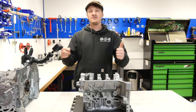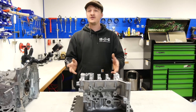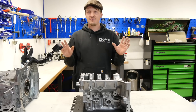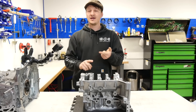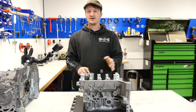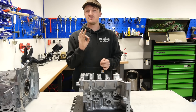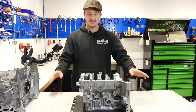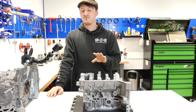So clean workshop is number one. Number two: always double-check the machine shop. When you want to rebuild the engine at home in the garage, invest some money in measurement tools like a bore gauge, a caliper, a micrometer, something like this. Double-check the machine shop and also the parts you get, like pistons and rods. It's very important and it can save you a lot of money.